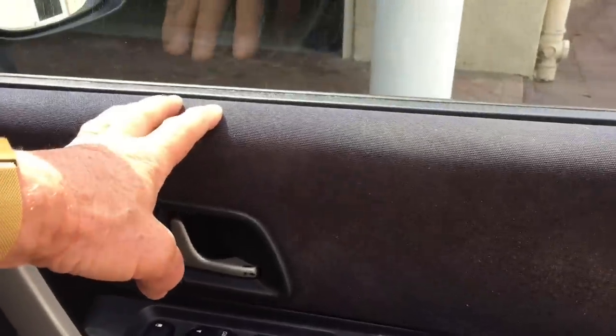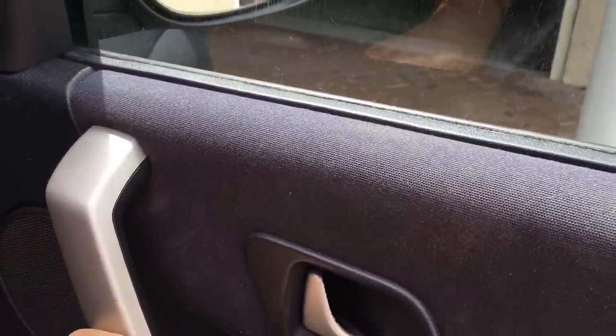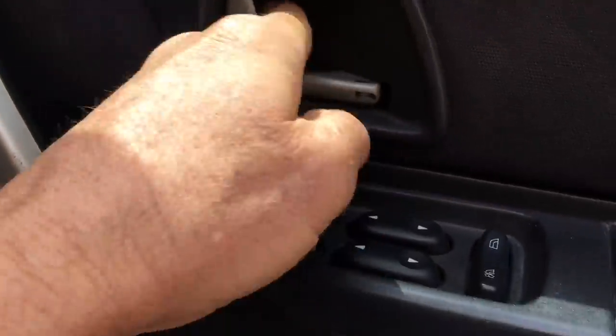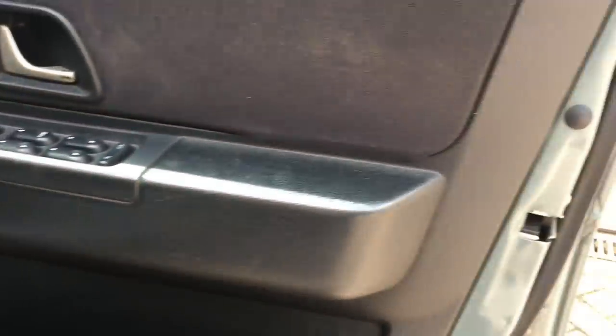Removing this panel is fairly straightforward. This piece of plastic is held on by clips and has to be levered off, which is a two-hand job. There is one screw in here to remove. There are some big posi-drive screws and bolts in here, here, and in here, and some screws around the bottom of this storage compartment, and then there are clips that hold it in. The whole thing then just needs a sharp tug to unclip it.